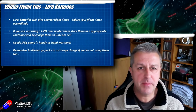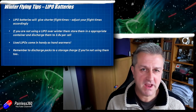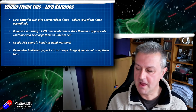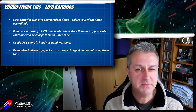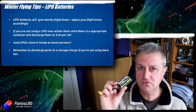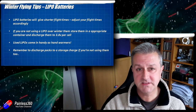The next thing to consider is the LiPo battery. LiPo batteries rely on a chemical reaction to release electrical energy, and how efficiently that reaction happens is a function of temperature. The colder it is, the slower the chemical reaction and the slower the battery can release power. So if you've been getting 10 minutes of flight time out of a battery in summer, I'd drop that down to about 8 minutes. Watch the battery voltages — flying FPV you'll find they discharge much faster. Don't rely on your summer timer settings or you'll push your batteries too hard, they'll puff up, and it'll be time to replace them.